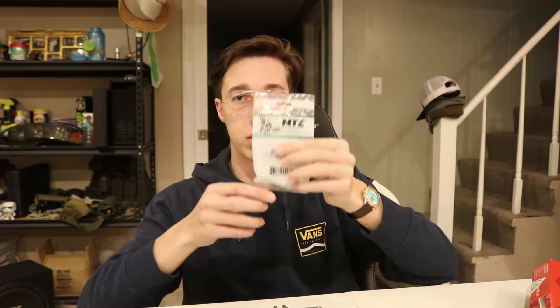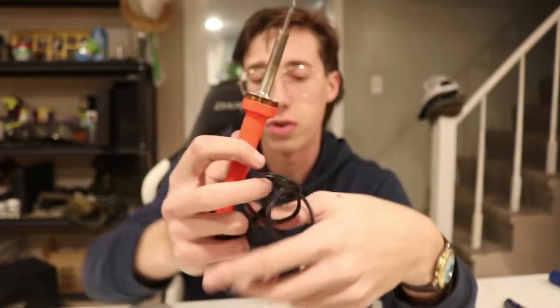I'm going to make myself a cup of coffee first because I am a bit tired, and I want to be very awake and focused while I'm doing this because I've never de-soldered anything before. Well, I guess I did like one thing but I didn't do it right. I'm going to do it right this time and use this de-solder wick. The first thing I'm going to do is sharpen the tip of the soldering iron — it's pretty broad right now because I've had it for a number of years. So I'm going to sharpen and clean the tip so it's a little more precise for de-soldering this board.